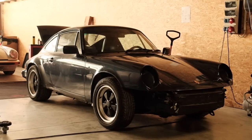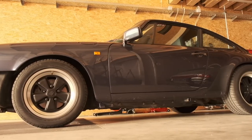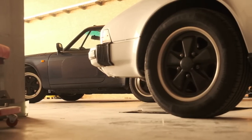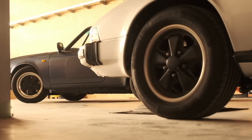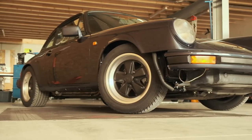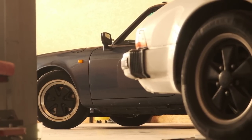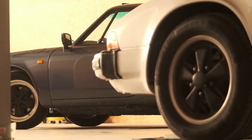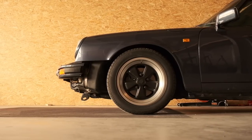Do you remember when earlier in this film I stated that I prefer repairing panels over replacing them whenever possible? Yeah, that is why. You see, to attach these wings is actually less difficult than one might think. Actually, it's fair to say that they pretty much fall in place. Large body repairs, however, if they are carried out without an according gauge, have the potential to ruin the fit and the gaps. A solid steel pillar of the workshop and a simple vise from the warehouse helped me to get this right.